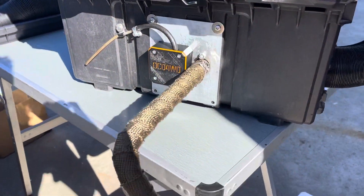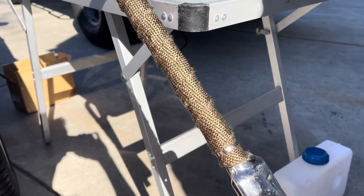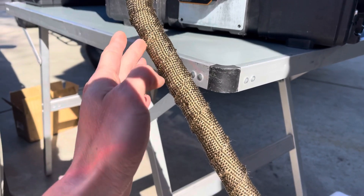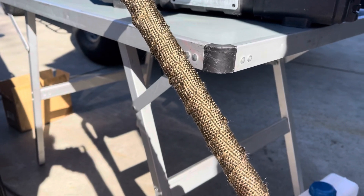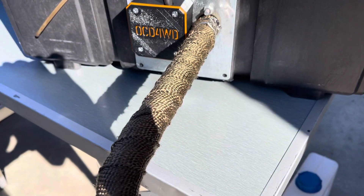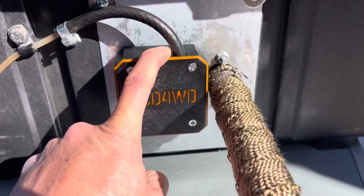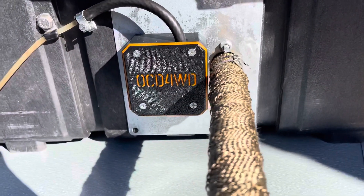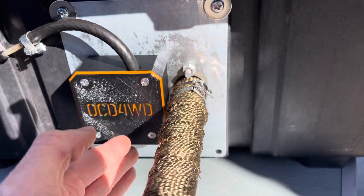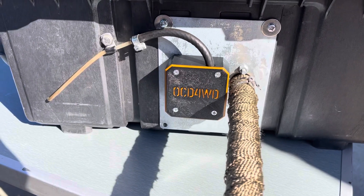I did a two-inch exhaust wrap - I think it's fiberglass, it says titanium but I don't think you're supposed to soak it in water before wrapping it. Hopefully that washed away; you can still see some of the glass. Before I didn't have the wrap, but I'm doing it now because of the 3D printed intake - testing to see if it will melt the plastic. If it does I'll have to redesign it or use a metal plate; hoping the wrap will reduce some of the heat.